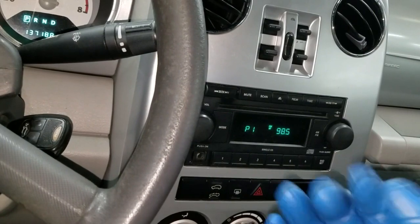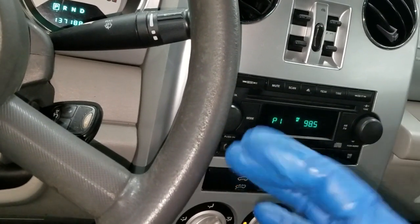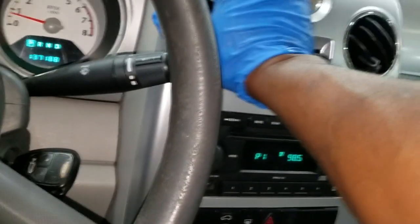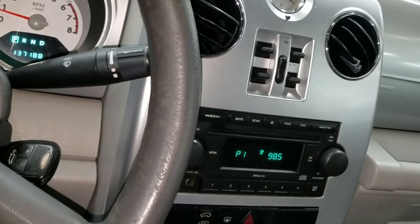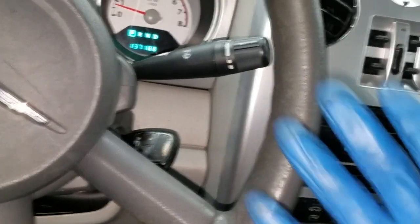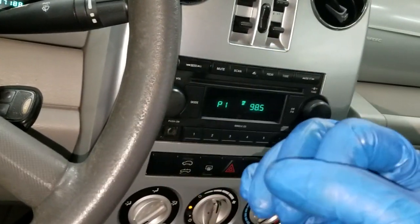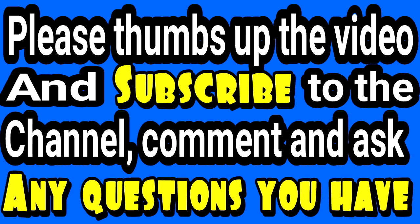I didn't go through every basic step - I do want to do basic videos for my students who are subscribed to the channel. I shortcut a few items because she's actually waiting on her car. But it is freezing in here now - your body temperature starts going down and you know it's cold. Ladies and gentlemen, we are done. This was a PT Cruiser but this diagnosis applies to any car - every car with AC. You're going to have an electrical portion and a plumbing side. You just have to separate them, find out which one is at fault, and diagnose based on those findings.